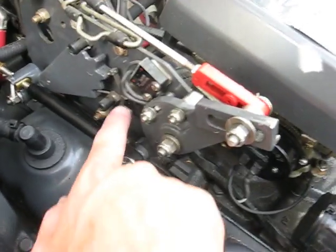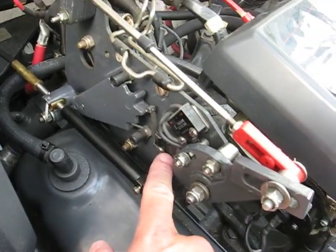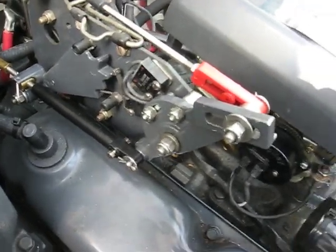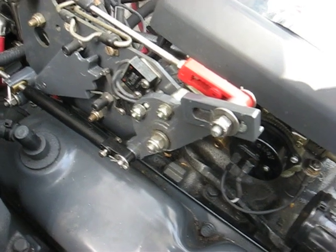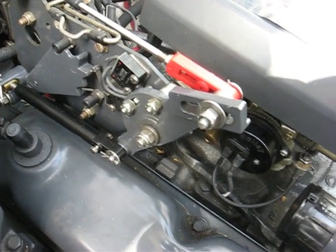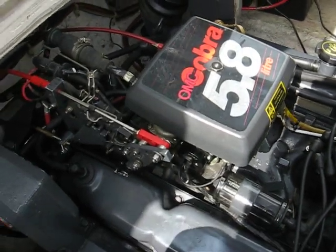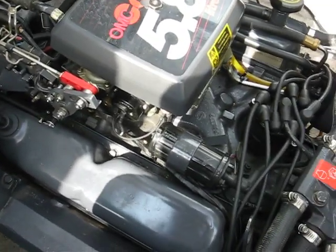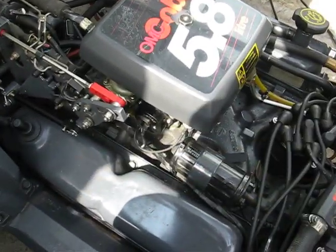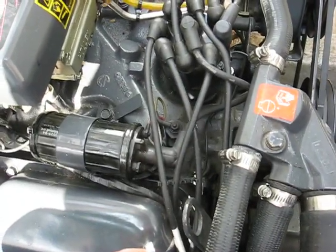The ESA — a lot of people don't understand — this is the interrupt switch, which you are keeping no matter if you do choose to bypass the ESA. The ESA is a module that commands the engine to cut out only part of the cylinders. When you bypass it, you are cutting the entire engine. I don't want to be in a position where the engine is completely stalled. I'd rather have it running — it just stumbles for a brief second. Mine is extremely smooth, so it might be worth a sea trial before you do it. A lot of people don't know which wire to cut — it doesn't matter, cut both. Run one to the ground and one to the negative side of your coil if you do choose to do it. They make it complicated in the directions — it doesn't matter which wire.